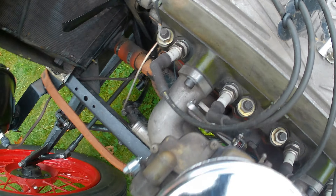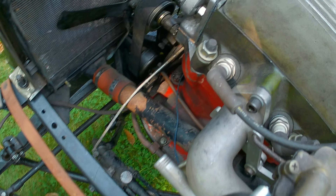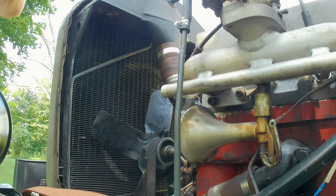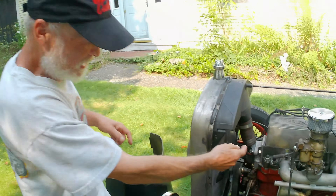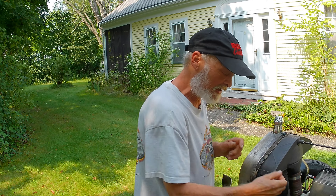Is this welded to the manifold? No — this bolt holds it, it's a round thing so it can't move. I cut it for the pipe, made a little round aluminum piece with the hole underneath so it can't move either way once it's on. Then you put the bracket on with a shoulder bolt — you can only tighten so far, so it's always going to pivot.